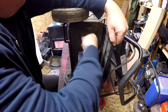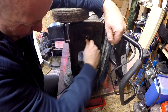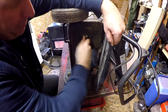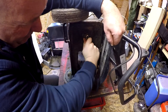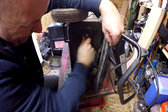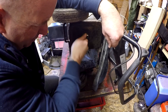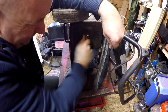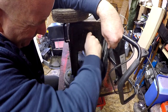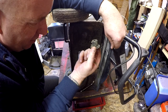Having an impact certainly makes life easier. Lots of people don't like using them because they think they're too aggressive — well they are too aggressive, but as long as you just go easy you won't have too many issues. I'm going to change my size of impact bar to a thinner one. That's what adjusts your gearbox tension. That's been on quite some time — it has a spring behind it and a collar. It's a fair old size bolt, and it's corroded. So you've got a washer, a spring, and a little plug as well.